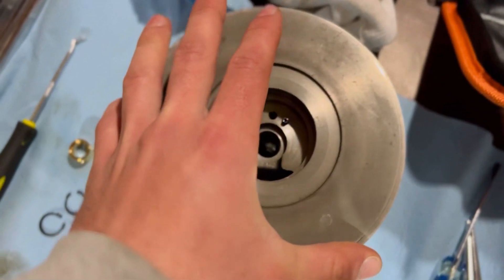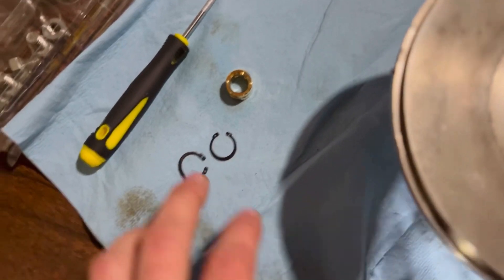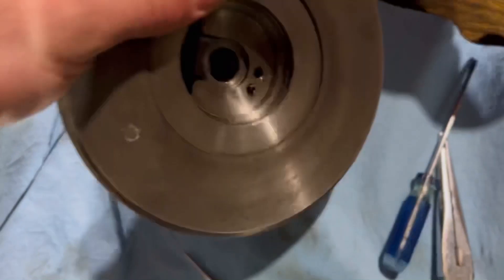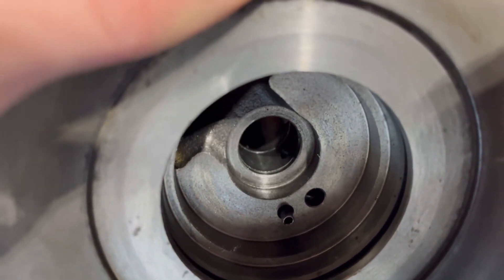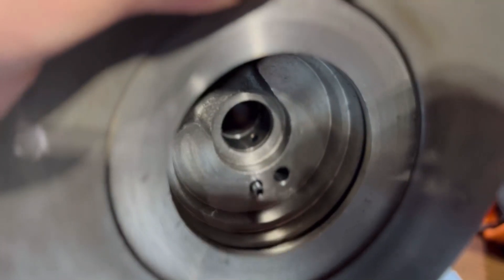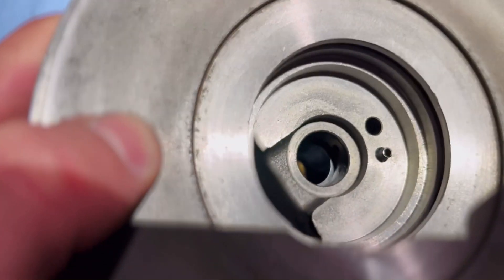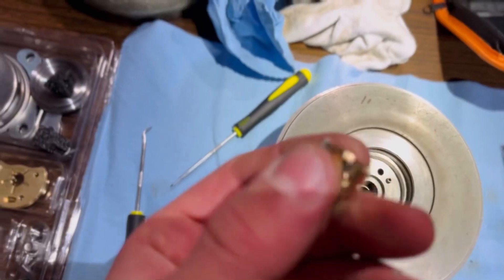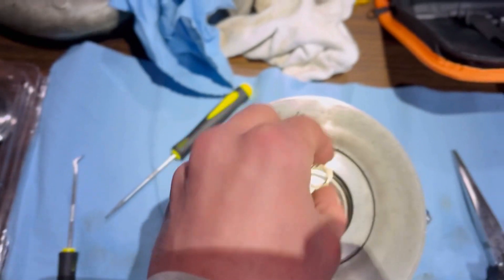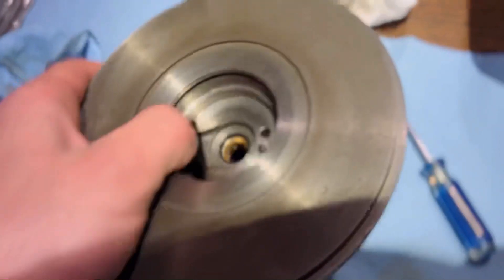Got it flipped around now. Basically what we're doing on this side is the exact same thing — two snap rings and a single journal bearing, same thing in between the two grooves. You can see the oil feed on the side. There's the first one in there. I'm going to put some oil on this journal bearing, drop that in, and the next snap ring on. That's now buttoned up — journal bearings are all in with the snap rings, both sides.